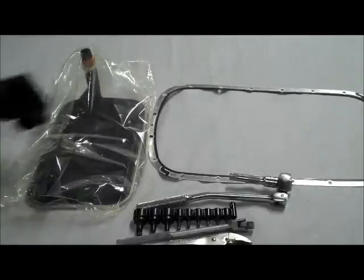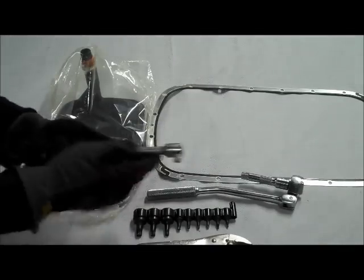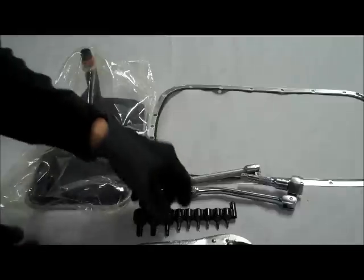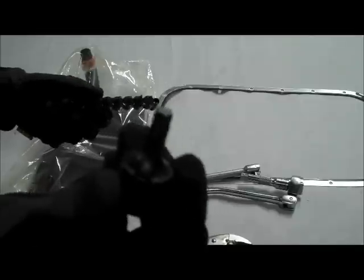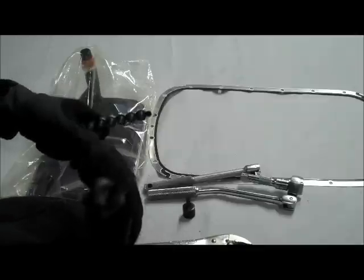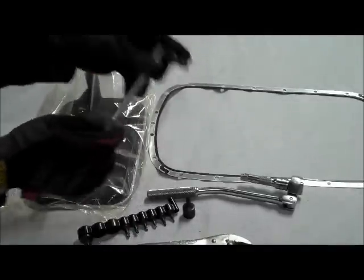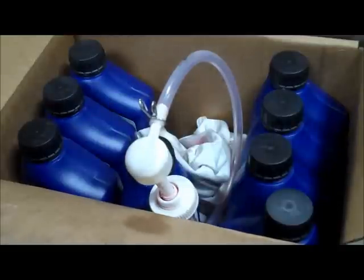The tools you're going to need: a 3/8 inch drive ratchet, and you'll need some sort of narrow 3/8 inch drive because the fill plug for the transmission is very difficult to get to — it's up against the transmission tunnel. The drain is going to use a T40 Torx and the fill is a T45. You'll have to get it into a relatively narrow location.